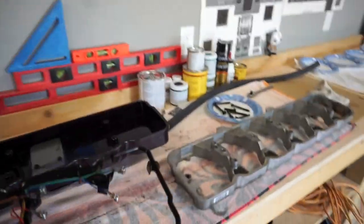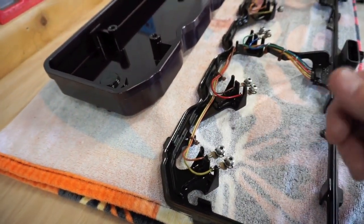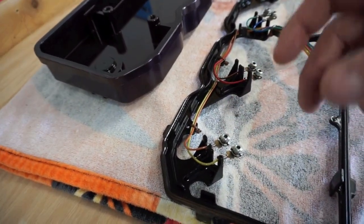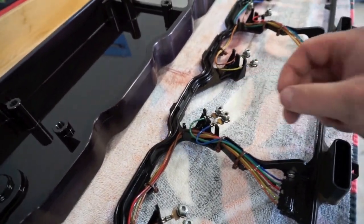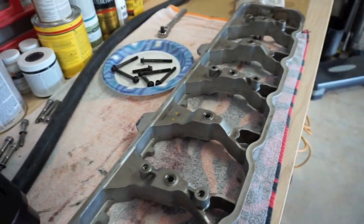When you're removing these small eight-millimeter bolts, don't do it with anything power — just use a ratchet. Because if you mess one of these up you've got to buy a whole new harness, and if you mess up an injector it's going to be an expensive mistake. Then next comes the rocker cover, and then we're on to the rockers.